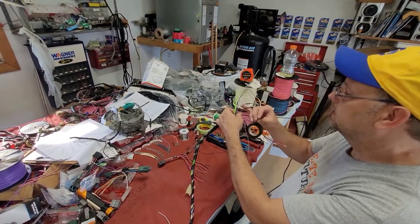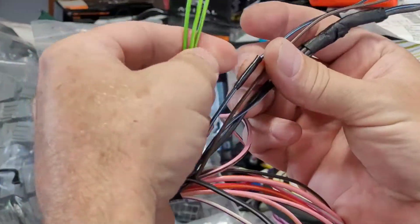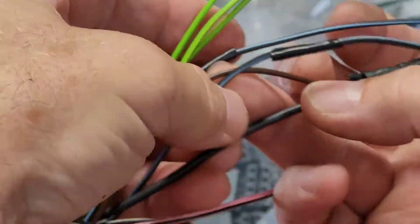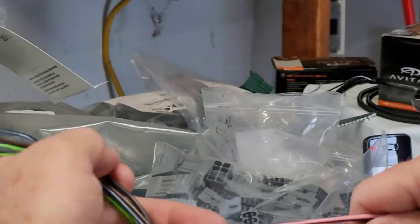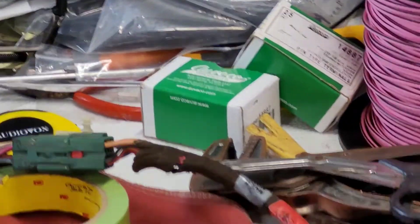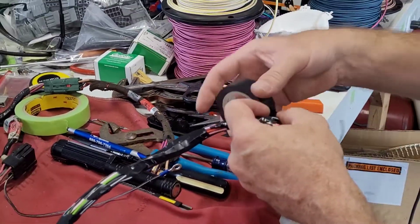When I get to the end here, I stop and start spreading these out. You want your three green with yellow stripes, your two black with blue stripes, your brown parking light wire, and your ground. This is that factory solder that I just left on there — it's fine. And then everything else you want going this direction, and I'm going to tape them up separately so they're going a little bit different direction when we get over there.